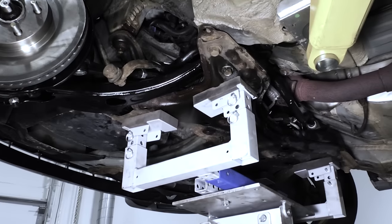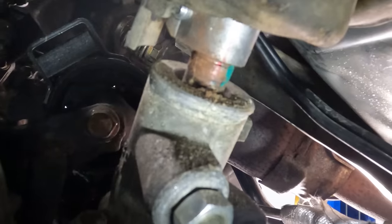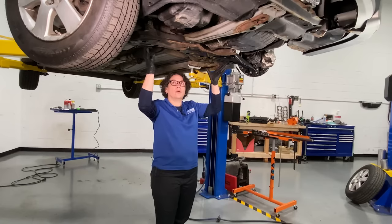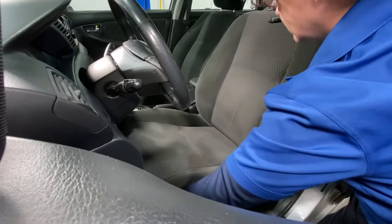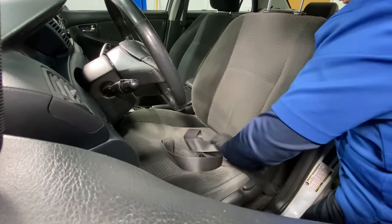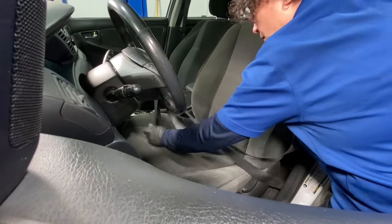I'm going to put a transmission stand here, but first I have to disconnect the steering rack. Don't forget — that rack is bolted to this subframe. Don't just drop the rack down attached because that's going to pull that steering column out — a lot of damage, clock spring, a whole bunch of problems. So we'll take that bolt out. Make sure the steering wheel is straight and locked. What I like to do is grab the steering wheel, center it, move the driver's seat all the way forward, then take the driver's side seat belt and wrap it around the steering wheel twice, click it into the receiver, and lock it in place. That way there's no chance of the steering wheel spinning.